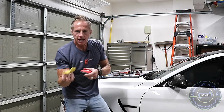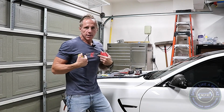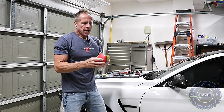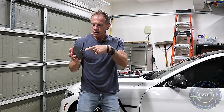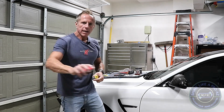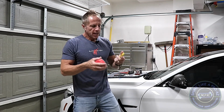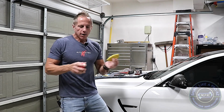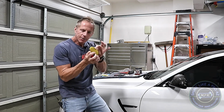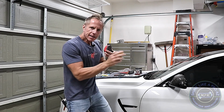So once again, everything's got its trade-offs. You know the three things I like about it. Now you know the thing that I don't like about it. So what I probably would do in my world, if I embrace this type of technology, the polymer rubberized pad, is use it for the big, wide open areas because it's going to be a more user-friendly experience for me. But I'm going to bust out a traditional clay bar for those tight little nuances of my car where I need a real tight little shape in order to fully finesse that area of my car.